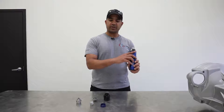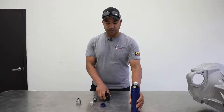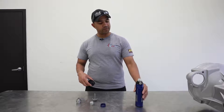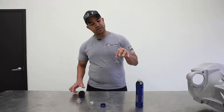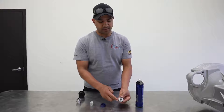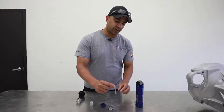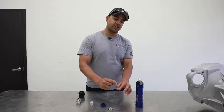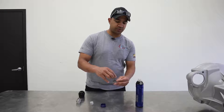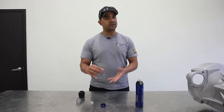What happens is you have your remote reservoir here — the oil comes in through a hose into this fitting, which we have blocked off for demonstration, goes in here, and it flows out down into the bottom of the tube here through a set of valving. The set of valving looks like this: very simply, the oil comes in between this little steel axle and this little aluminum piston, goes in there, and presses against this washer valve. This washer valve presses down against these springs and lets the oil out. So in order for that oil to move the valve against those springs, we have to build up some pressure, relieve the preload caused by the springs, and the oil flows out.